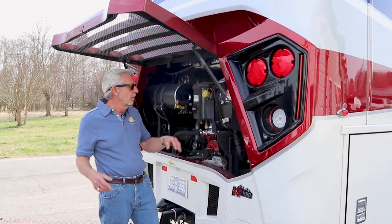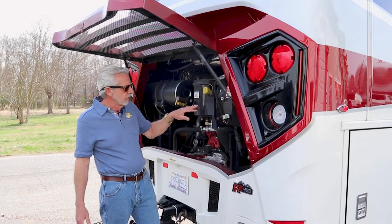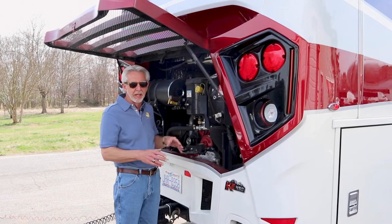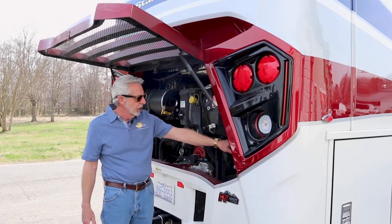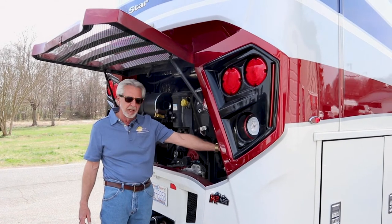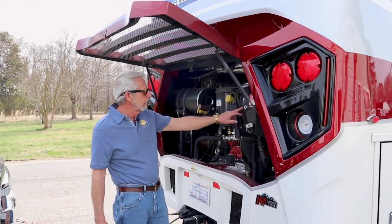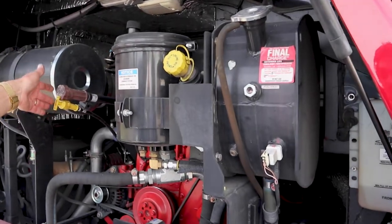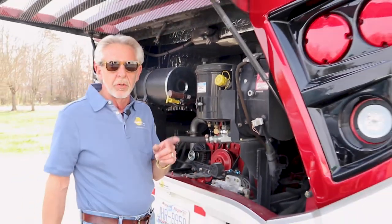Talking about your chassis and engine — before you go, check your coolant level, your oil level, your transmission level. Check those fluids because it's much easier to take care of this situation in your driveway than on the side of I-40 or I-20 or in the pouring rain at a rest area. This coach uses an Oasis heating system, so I always check to make sure my boiler fluid is at the proper level. You have a gauge for your coolant level, and that uses a red antifreeze — check engine and transmission levels. Also carry one or two spare fan belts.